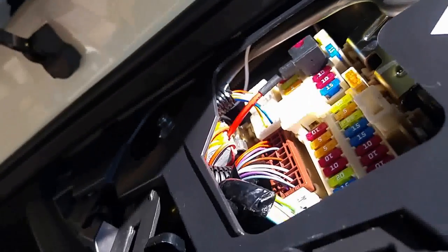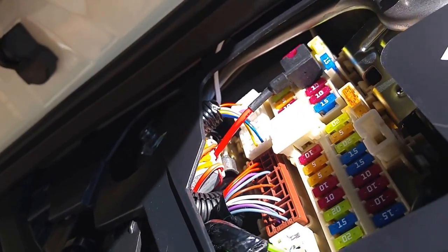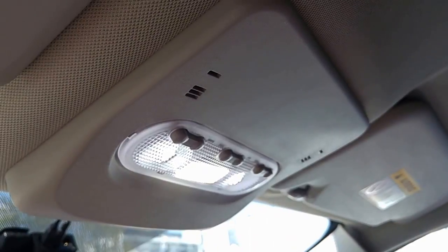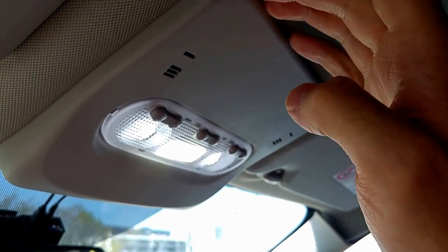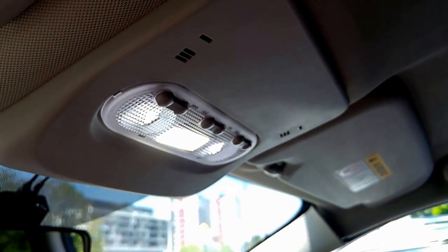You can see only small bits right here — I'll fix it just a little bit more. The cables go under this plating and inside towards the fuse box area. There's not too much visible cabling; it's hidden inside, so it doesn't look too bad. I can hide it from Nissan if needed. I hope I've shown you how to dismantle the roof lighting in the Qashqai J11. Goodbye!